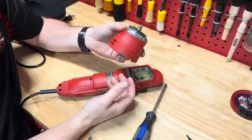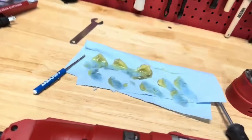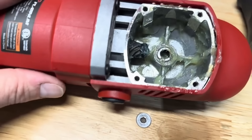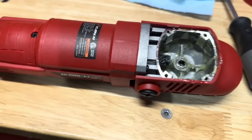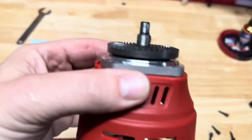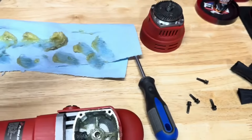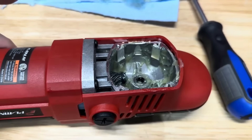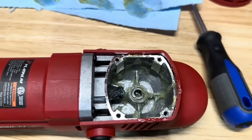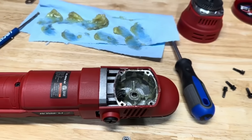Either that or I might give it away to somebody who needs a good polisher. They didn't skimp on the grease overall — they put plenty in it — but that gear was completely dry. I'm going to take a napkin, get all that out, and refill it with grease. One thing I'm noticing that's kind of weird: I don't see an O-ring on here — normally there's an O-ring on all polishers I've taken apart — but it didn't spew any grease while I was using it, so I think it'll be okay. Every polisher I put Amsoil grease in ends up being a little quieter.